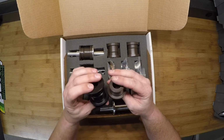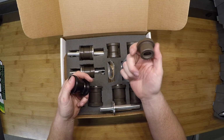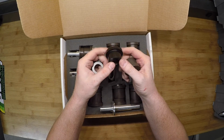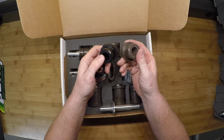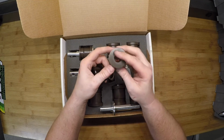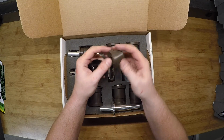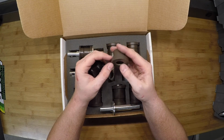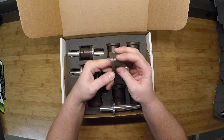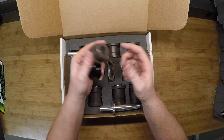So, the only other difference between the standard Delrin kit and the Delrin AF kit is the color of the Delrin. Standard Delrin has approximately the same density and strength as Delrin AF, but Delrin AF has Teflon impregnated in it. I use a Delrin that is impregnated with Teflon fibers as opposed to Teflon powder because it gives you a little bit better surface coefficient, so you end up with something that's a bit smoother when it's rotating.